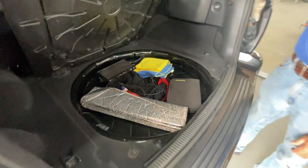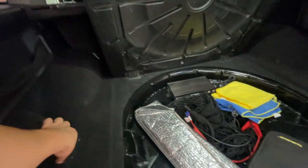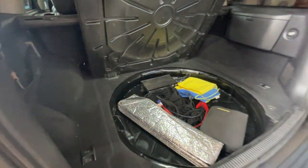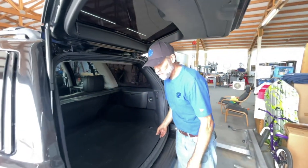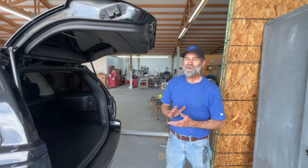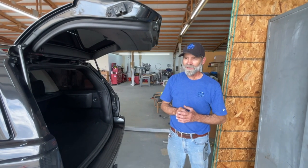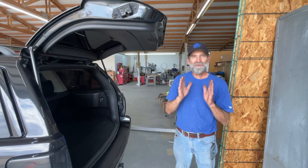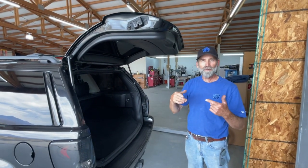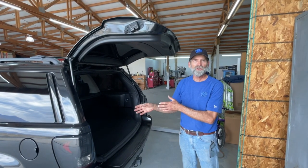Oh, I wanted to ask about this. You have the tank tuck, but what I like about yours is the hoses. They're not exposed. A lot of people run them through here. How did you do that? Well, you do end up drilling a hole through the frame. Then I cut a piece of drive shaft out of a pick-apart, I believe on a ZJ, about a 5-inch piece. I ran that through the frame and welded it back in solid. In my opinion, the frame is actually stronger now than it was before.